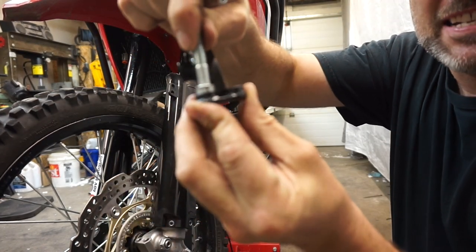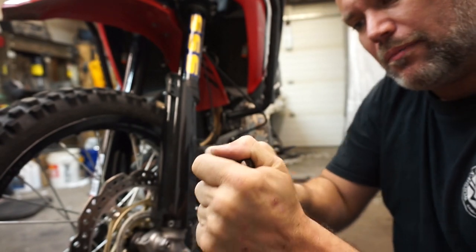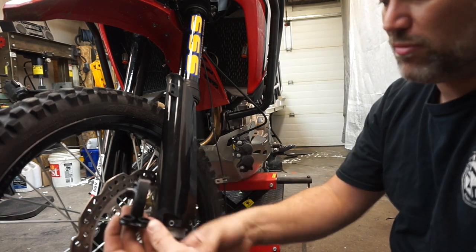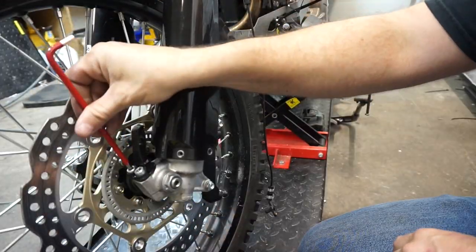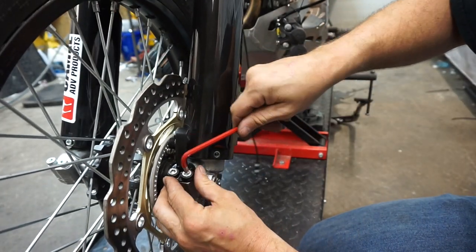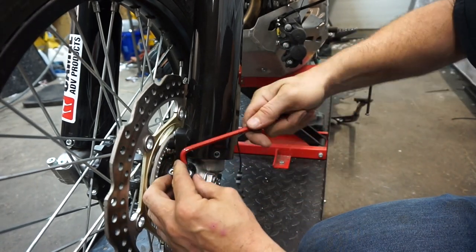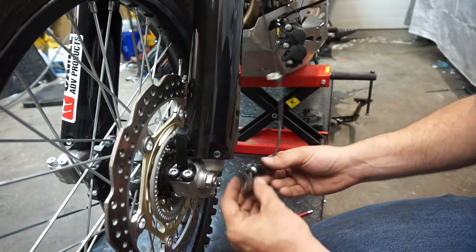You can see they're a nice tight fit. When I get this powder coated, if I do use this one, I'll probably have to turn the heads down on these just a hair to get them to fit. But tight is better than loose, and I'll probably use stainless hardware in here to keep corrosion to a minimum. We've got about a millimeter and a half of clearance there. It seems to get a little bit closer to the tone ring when I tighten these bolts up, but that's good — it's about the same as what was from the factory.